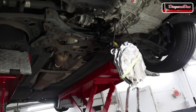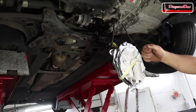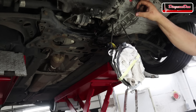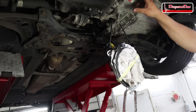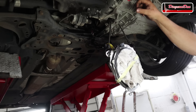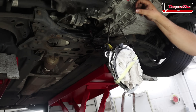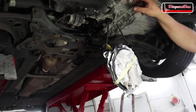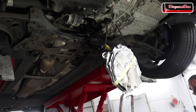Another thing I noticed: with the donor resolver hooked up, every time I try to turn the vehicle on to the crank position it actually tries to spin the electric motor. Of course this won't work properly because the tone wheel isn't spinning on the actual motor so it's not timed correctly — you can see it shaking. It definitely was not doing this before with the old faulty resolver. Getting in the car and putting it in the crank position a few times shows the motor shaking.